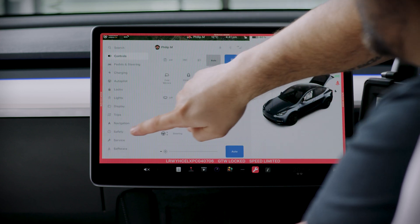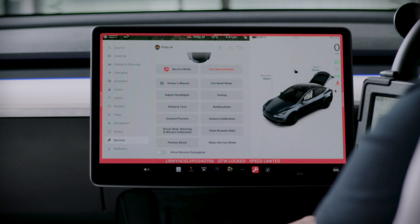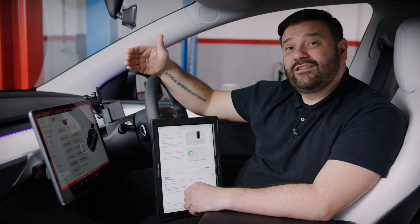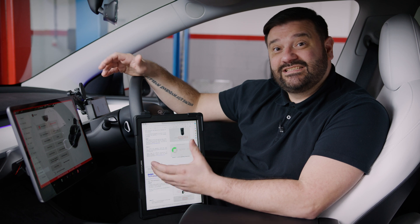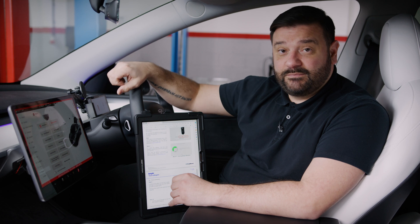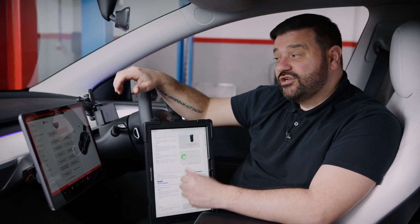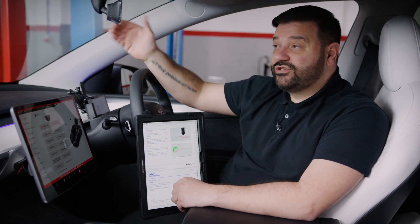Back in the menu, go to Service, scroll down and you'll see an option for Camera Calibration. This is done whilst driving — there's a simple progress bar. Slow roads are not going to work particularly well; you're going to need to bring the vehicle speed up to around 30 to 50 miles per hour, or even up to 60 mph (100 km/h), so the calibration happens much quicker. Tesla say it can take up to 100 miles or 160 kilometres to complete, and this can be done by the technician or handed back to the customer to finish.